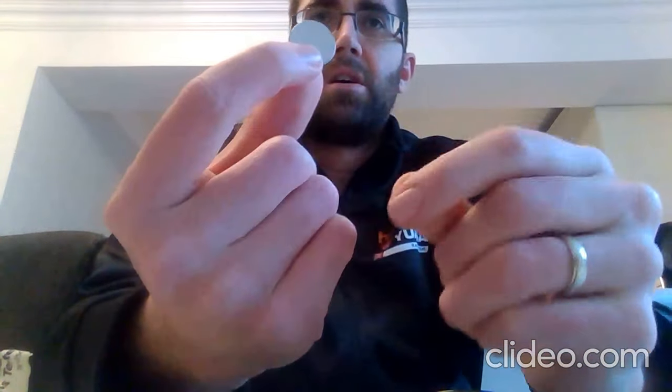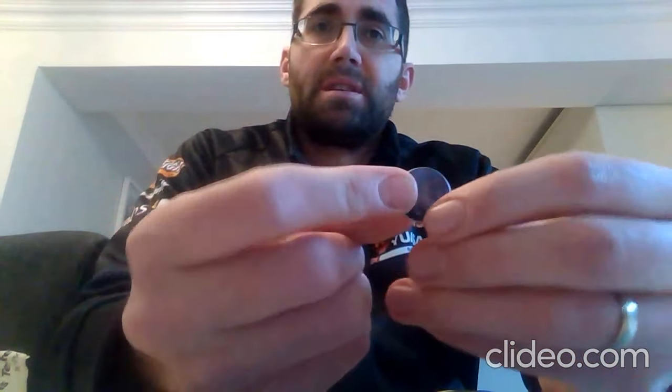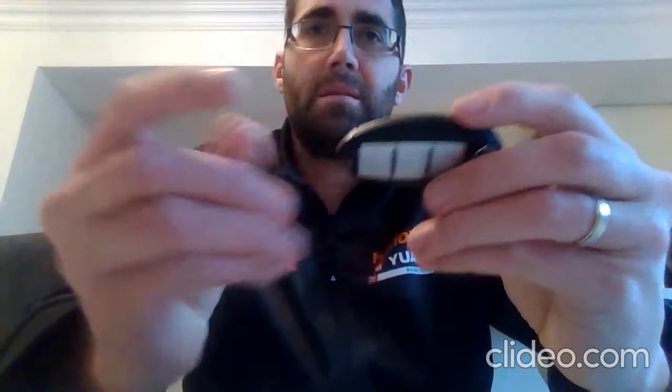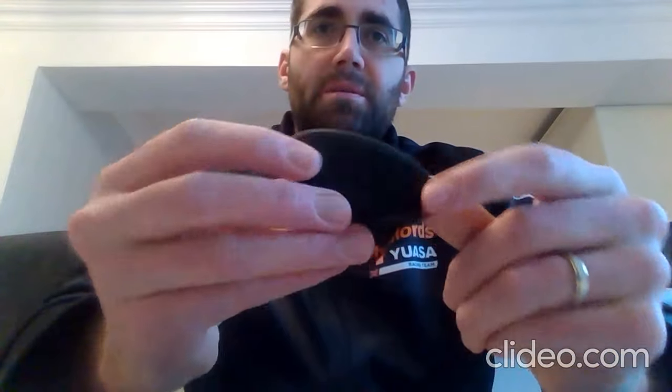Oh, where did I put that? There we go, which is a CR2032 battery. I would recommend getting a decent brand because then it will last longer, obviously, and it's just worth it. I think the difference between unbranded and a branded one is a few pounds here in the UK, so I'd recommend that. Right, so let's change the battery. Get your key. Take any key rings off it, it's ideal just so you've got more playroom. And the first thing you need to do is remove that physical key which I showed you outside.